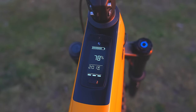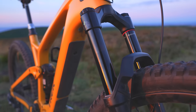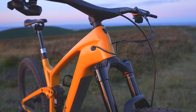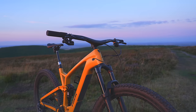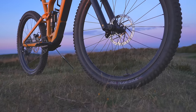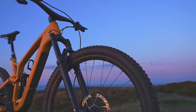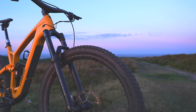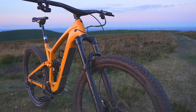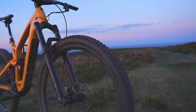In mode two, time goes down to 2:36, and in turbo it goes down to 2:01. I've dialed in the settings a bit with the RockShox and the new Charger 3 damper and Buttercups. I noticed I'm using quite a lot of the travel — I'm more in the last third — so I'm going to play around with the rebound damping. The Bontrager carbon rims look absolutely stunning from the front — really light, the entire wheelset is under 1,800 grams. The 2.5 SE5 tires are really comfortable trail tires, and they haven't put on a weak cross-country tire — these are proper trail tires and you can ride pretty hard on them.